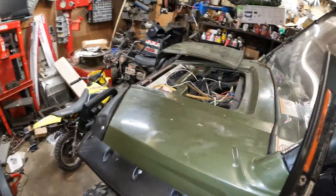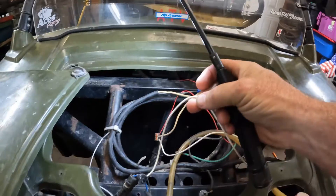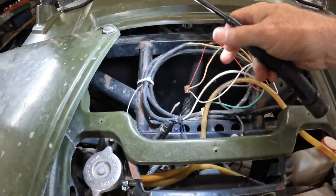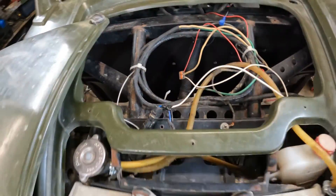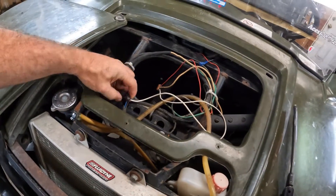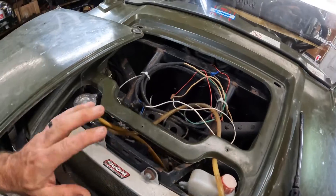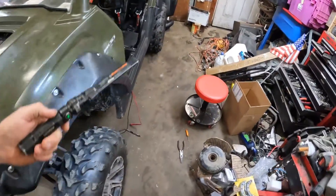I came up to the front and checked the fan connector. It still had the wire from where the original owner had it straight-wired, but it's plugged right in here. I hooked power directly to the fan and the fan comes on, so I know the fan itself is good. After all that, it still didn't work.